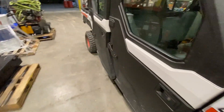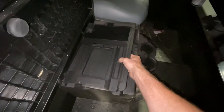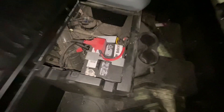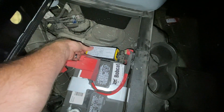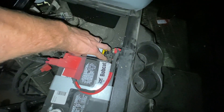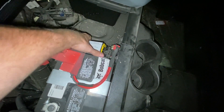So we're going to come over here to the passenger side, and then we are going to lift up this seat right here. Let me take this tray out — you can see our fuse box right there. Lift up these yellow tabs, squeeze in these two tabs on each side, and the lid comes right off.